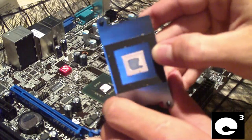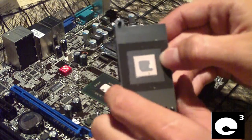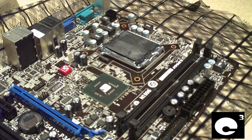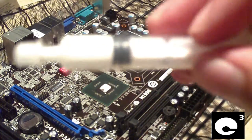The reason I dislike the pink stuff is because it's a wax. It's back from the old Pentium 3 days — they should have quit using it six or seven years ago. Thermal paste such as Arctic Silver 5 or white paste does a much better job of transferring heat from the chip to the cooler because it's a grease rather than wax, and it's much easier to work with when you're replacing the heat sink, CPU, or whatever.